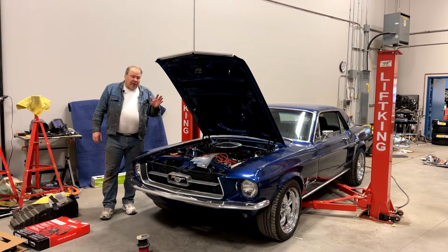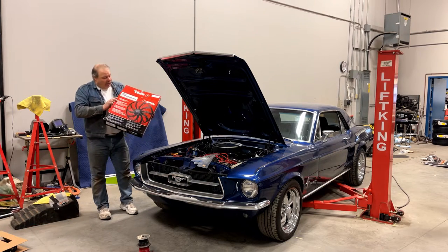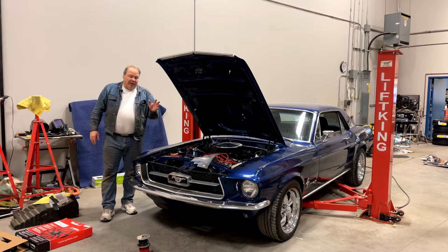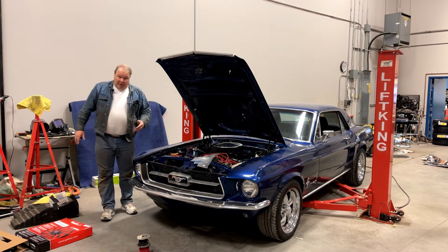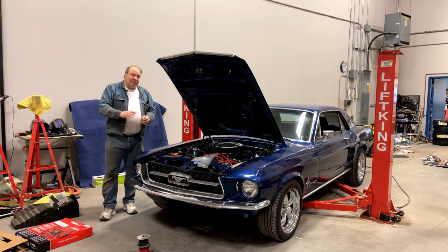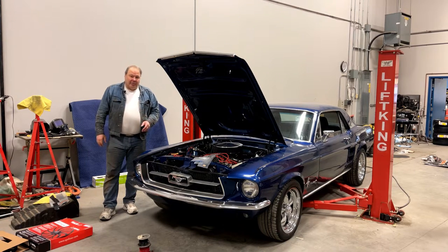When it comes to a fan on one of these kinds of cars, any way you slice it, it's a custom job. So it's up to you to spec out the parts and get them right. The first thing you're going to need is a fan. I chose this Spal fan for the project. Spal makes a huge variety of fans in various sizes. In my experience, when it comes to CFM ratings, if Spal rates a fan 2000 CFM and somebody else rates a fan 2000 CFM, the Spal fan will invariably deliver more air.